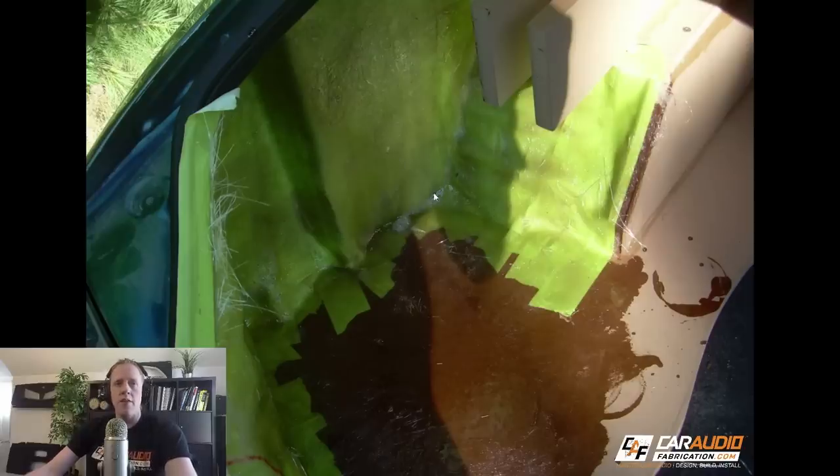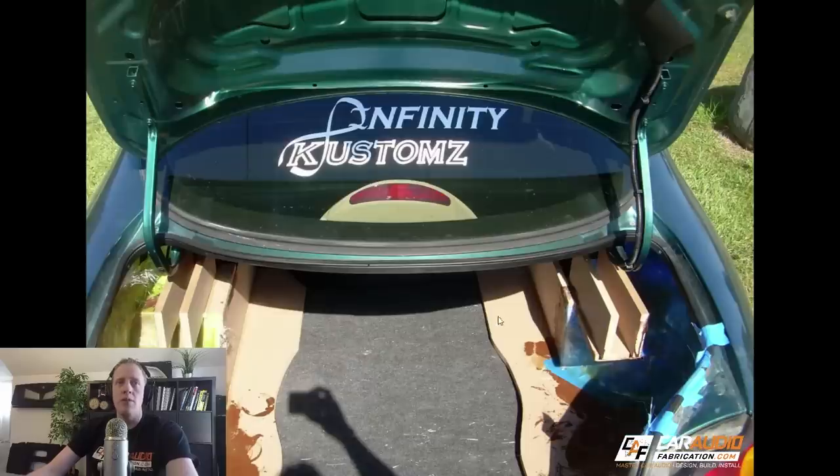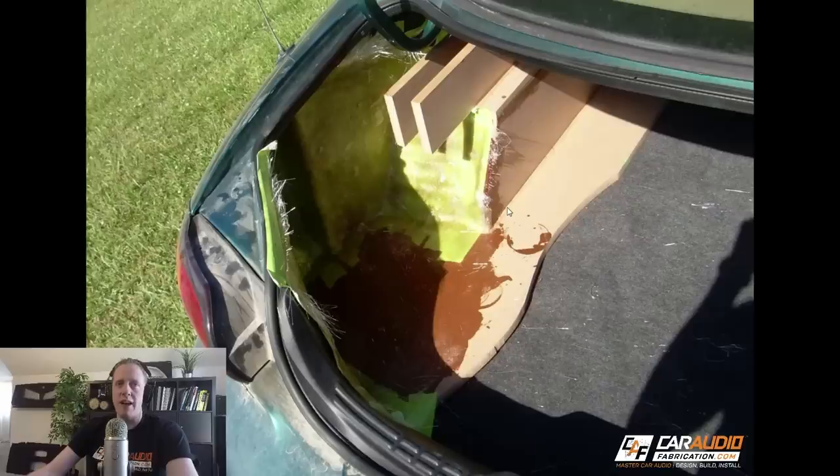You can see down in the corner here I do have some bubbles. When you're doing the fiberglass process, bubbles are the enemy - a bubble is not strong. I should have really made sure that when I was laying up this fiberglass material, I dabbed the resin completely into the glass and smoothed it out as much as possible so that there were no air pockets. On the right side subwoofer enclosure, I made a similar mistake - I again covered the tape on top of the wood, which ended up being a problem.